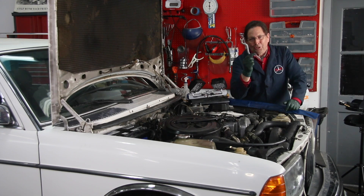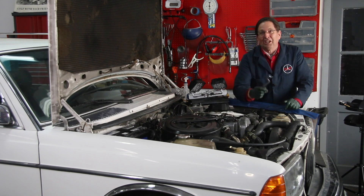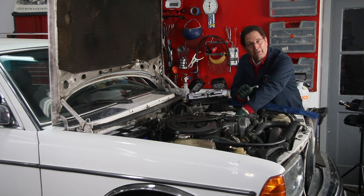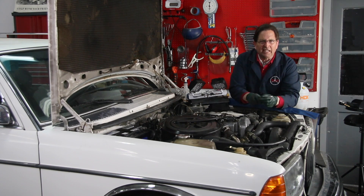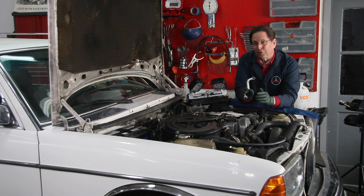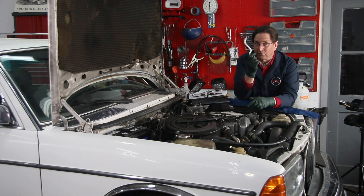No matter what method you use, you need this wrench. You cannot believe how fast you can do this job with it. Trying to adjust the injection pump on these old 616 and 617 diesels without this wrench — good luck. We spent probably eight hours going through three or four evolutions of the bend in what we call the snake wrench, to get to that bottom nut on the injection pump mounting flange and that really difficult back bolt on the reinforcement bracket — right in front of the oil filter housing. That's the reason for the really weird bend and offset on the box end.